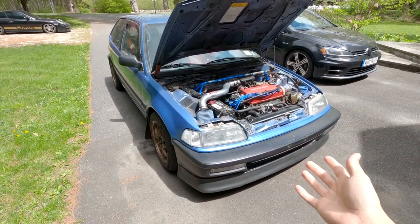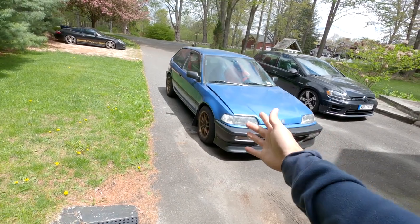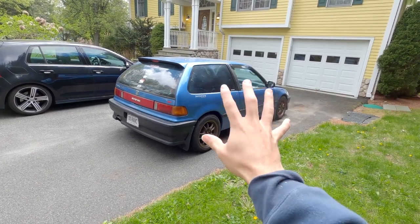This is an extremely unreliable engine. It does not work very well — it has massive idle problems all the time and people have nothing but issues with the D15B2. So if you are planning on buying an EF hatch, buy one that has a D16 engine in it or has already had the MPFI swap done. This may be easier than you think because a lot of people have done this already — it's not something new to the Honda world. There are plenty of EF examples out there that already have the multi-point fuel injection swap done.